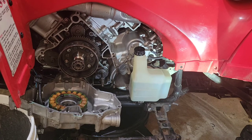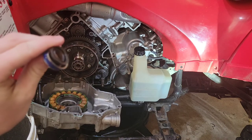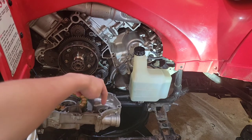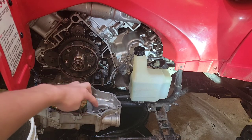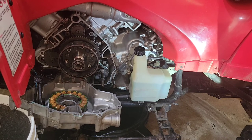So what I did last night is ordered parts. I ordered a stator gasket seal, and I ordered a water pump. The seal for that, I had to damage to get it off, but I ordered one of that, and I ordered it in a kit, so it came with a gasket, a seal, and a bearing, and it's this bearing down here. Doesn't really need it, but I'm going to replace it anyways. And I got two tubes of RTV, which I'm going to be using.